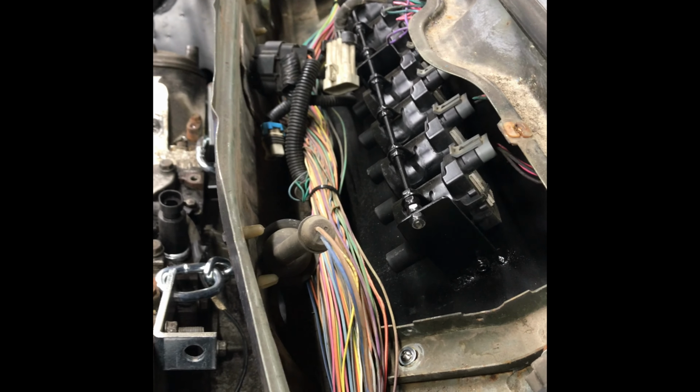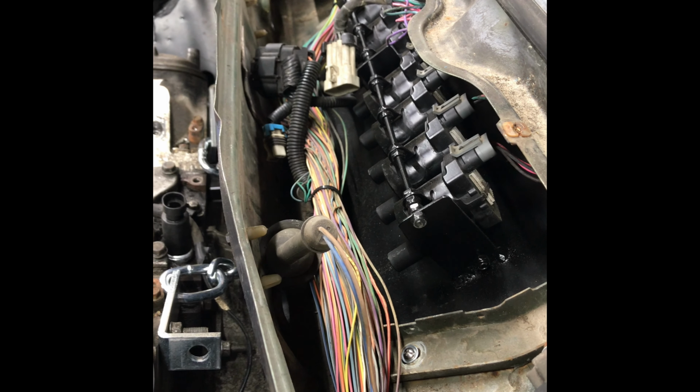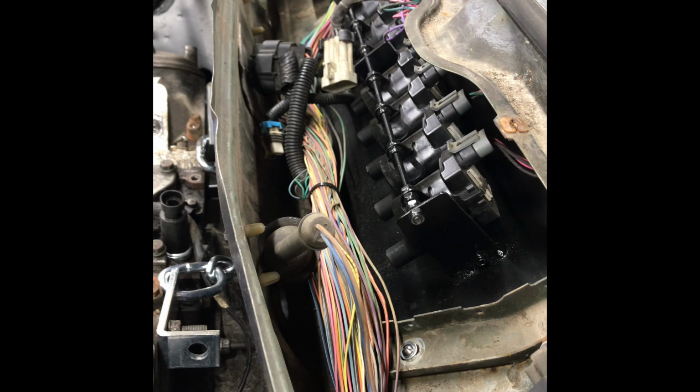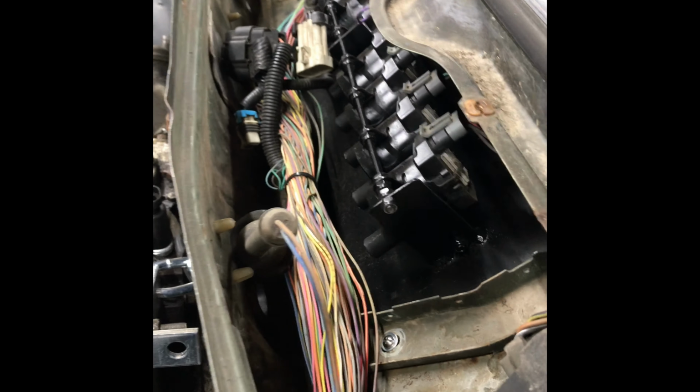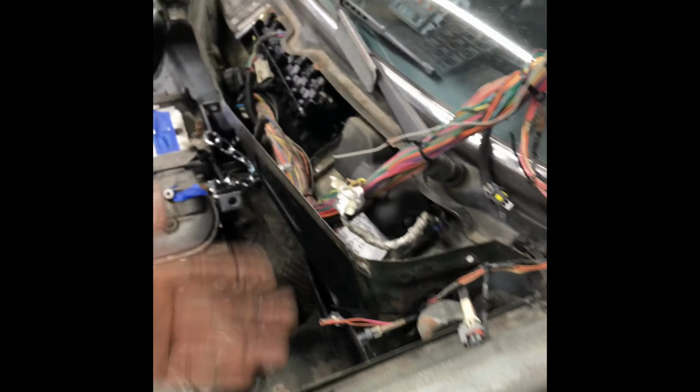Got a truck harness from my parents down in Ohio, delivered by a friend. It's a red-green harness, so it's a drive-by wire. So I gotta toss in some connectors for my throttle body because I'm doing drive-by cable. I gotta do a handful of other stuff on it. I gotta shorten the whole thing like 3 feet.